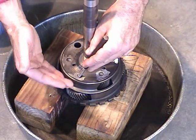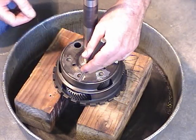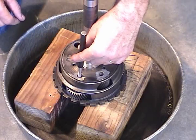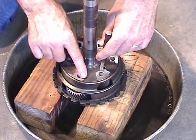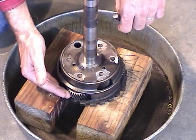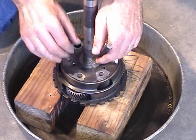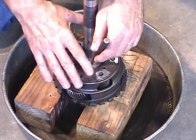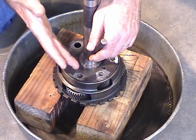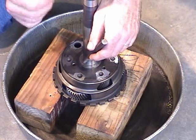What I want to do is remove the short gears first. Once I take the short gears out, I can remove the sun gear and the washer behind it. Now, this is an interference fit, so you're going to have to hammer it all the way out — it's going to be tight all the way through. The pins may have little burrs on them which can damage the needle bearings. Also, no matter how careful you are, your punch may wind up damaging one of the needles. So once you get all of the needles out — and there are little spacers too — check them for damage. If there's any question, these spacers and needle bearings are available and you'd want to replace them.